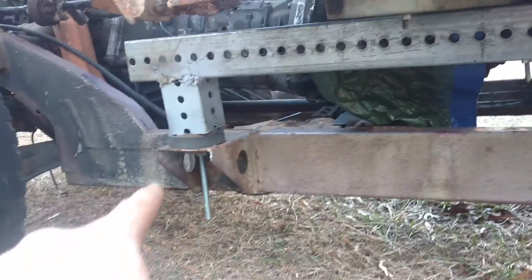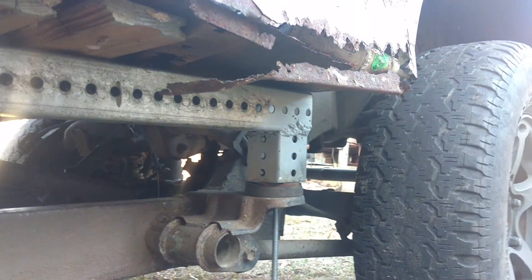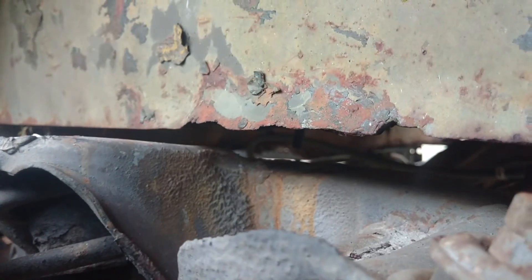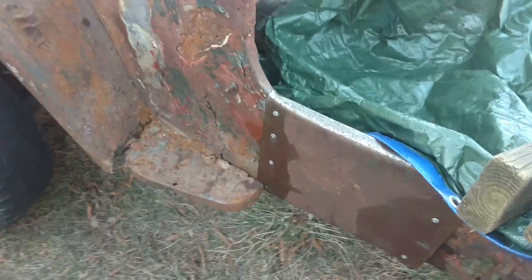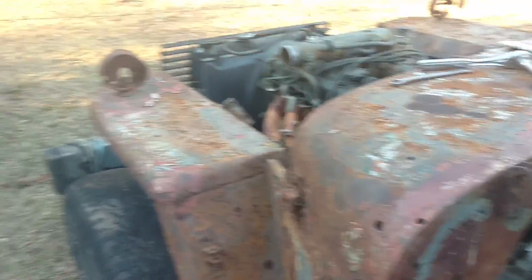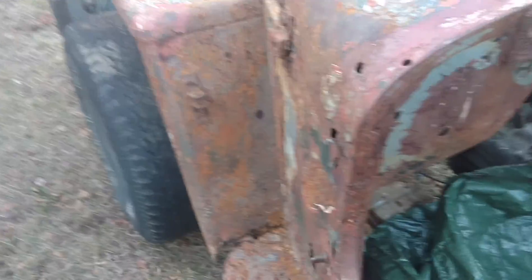I've got custom body mounts — I'll cut these bolts off right there so I won't knock them against a rock. Got it suspended so that the tub just barely clears the frame. I have to jack this side up; the other side has plenty of clearance. If I go over a bump it might hit, but it'd just be a rattle. The steering's tight and responsive — I hope it won't break and kill me going 50 miles an hour down the road. I'm pretty happy with it.